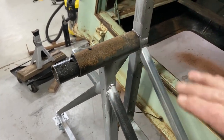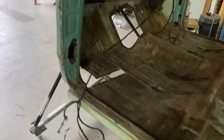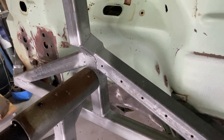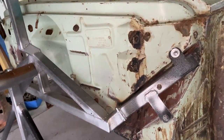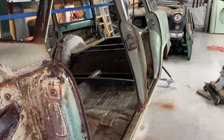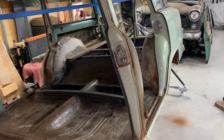The other component you've got to get right is the height off the floor relative to the body line of the car. The body line of the car - going down the other end to show you - is this little component here, which is the true center of the car. It happens to be where the radio bolt would go through to pick up the back of the factory original radio. To get the center line, I set the car up level on the sill, then set up my laser so it shot through from one end to the other, giving me the height I needed. Buying it from Tim meant those center lines were already pretty well marked.